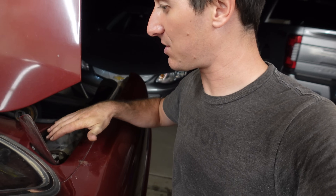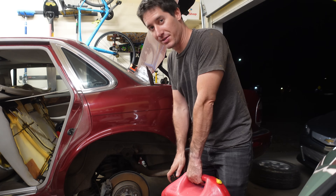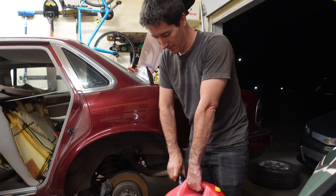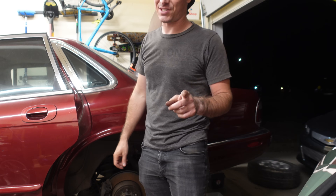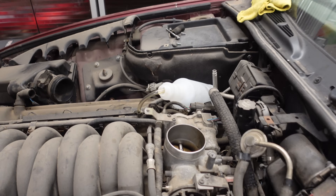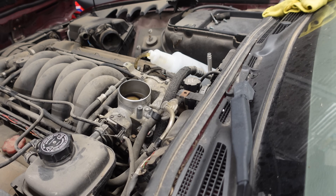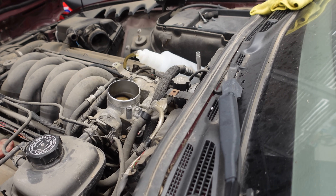I got the quick disconnect tools back out since they didn't do anything for us anyway, and everything is mostly wrapped up. Filler neck's back; the drain for the gas cap isn't back yet but basically everything else is. I've got five gallons of nice fresh premium here — two days of smelling horrible old gas has been terrible, my whole house and clothes smell like it. I'm adding it in with a funnel. We've got at least half the can in there, which should cover the sock. I left the Schrader out to purge the line first — let the pump run. Some old nasty fuel came out, then nice fresh fuel started to come out. That works for me. The Schrader is back in the fuel rail.